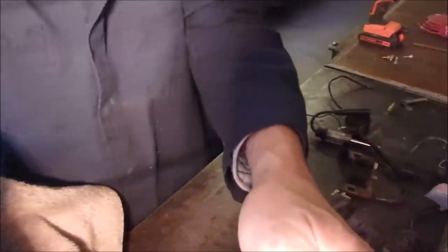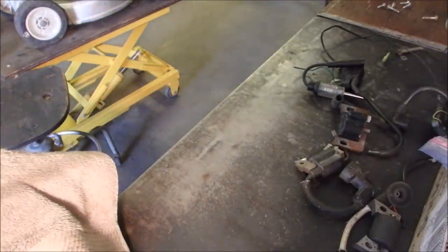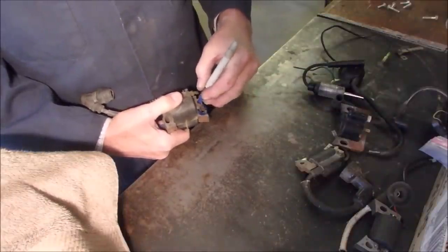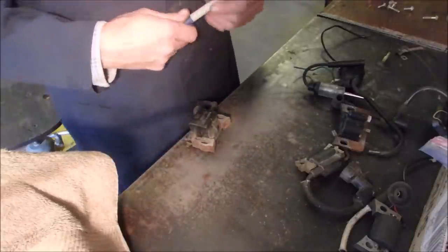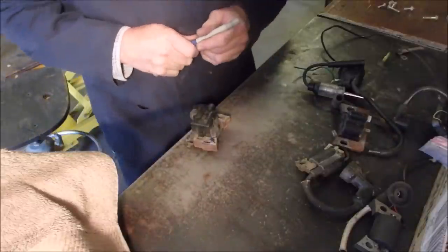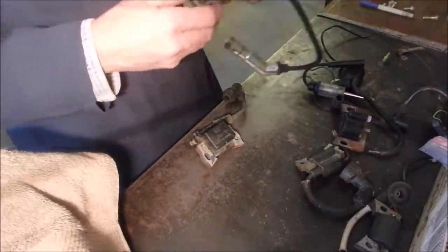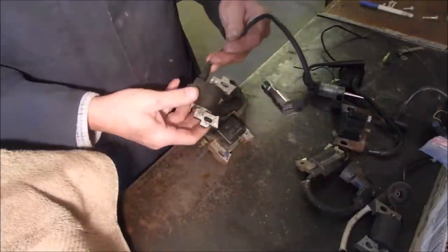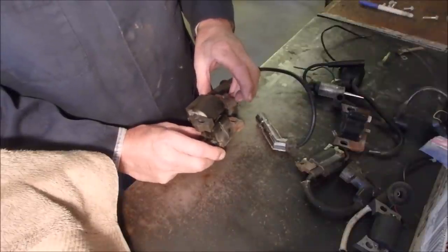My benefit is that I've been collecting parts for years. Let's get a felt pen and mark this one so that we know — just put a blue mark on here — because sometimes when you're checking out coils, it's easy to get them mixed up. Let's do one on the top too. Now, the big thing is the circumference of the flywheel. I kind of was digging this one. The flywheel's the same, circumference is the same. But there's a polarity on the magnets of the flywheel, and if they're not right, you won't get a spark.